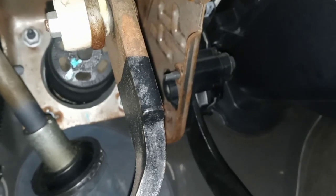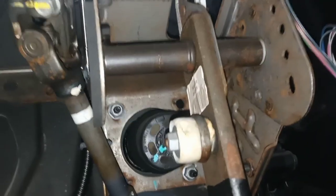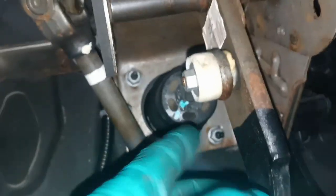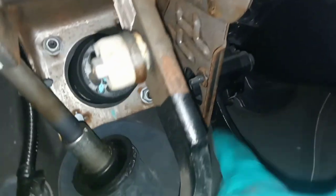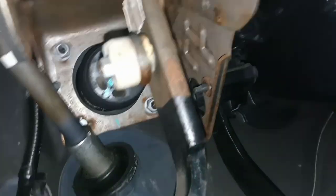Now there's no good way to record this, so I'm actually going to remove the whole box and then show you what it looks like on the side — bolting it and what it looks like outside the car. So I'm actually going to remove the whole brake pedal assembly. But clearly, to remove the gas pedal, all you have to do is remove the three 10mm bolts. So I'll go ahead and show you that.